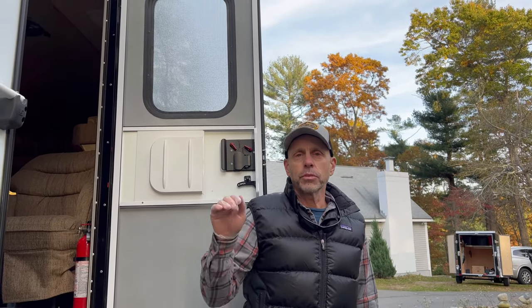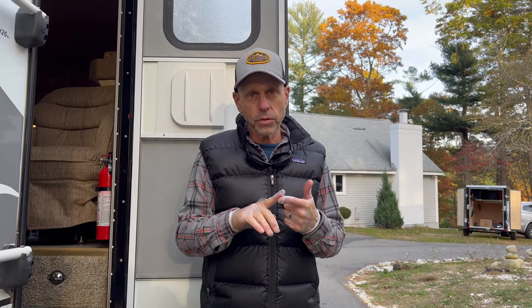So you can see that draw? Yeah. All right. Good. So we just started with the kitchen sink. We did the cold side and the hot side. We're going to go through all the systems. We have the bathroom sink. We have the toilet, the shower indoors, hot and cold. We have the shower outdoors, hot and cold. And then we're going to pour antifreeze into every single one of those drains, to make sure that the traps have antifreeze in them. And then we'll pour additional fluid into the toilet, and enough into the drains that will have a residue level in both the black and the gray tank. So that'll keep everything from freezing.